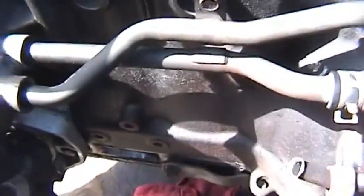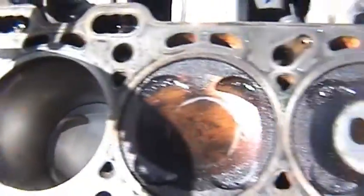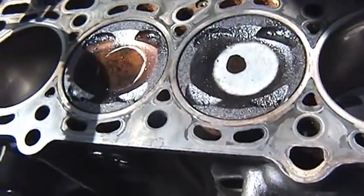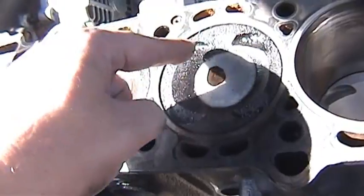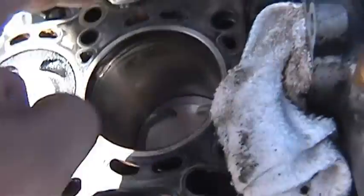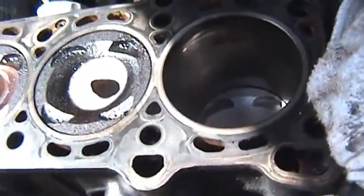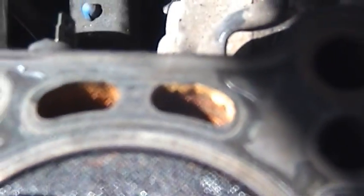Here are the results from cleaning up the block from the other day. It has started rusting a little bit in some places, but not so much that I'm worried about. Everything else cleaned up fairly well. I've gone at the pistons and cleaned those up. I've been using an aluminum and nylon brush — aluminum to clear the big surfaces, and then the nylon brush to really get up in those little corners. There was a tiny little ring around the edge, and I expected it to leak a whole bunch, but it didn't do that, so I'm pretty happy. It means the rings are sealing fairly good. But as you can see, my coolant passages have started rusting — rusting fairly good, too.